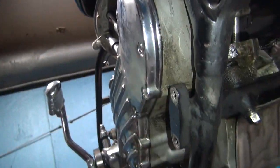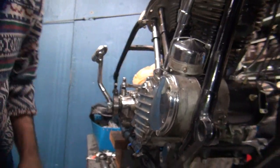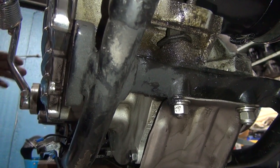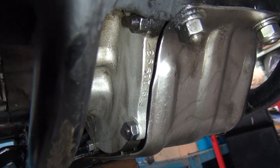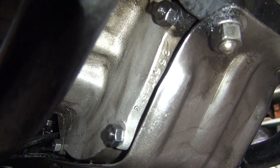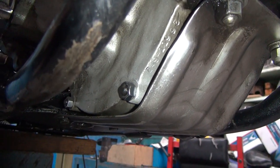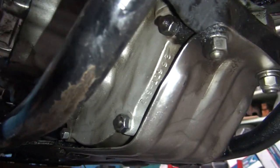There are some numbers down here on the case — like VIN numbers, casting numbers on the frame — so it's not a repop. You can actually see them now with all the grease on there. It reads two four nine dash one one nine nine, so it's a '49 case. That's the year — 1949. The extra digit on the VIN number denotes it's an export case, sport bike.